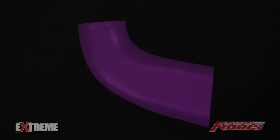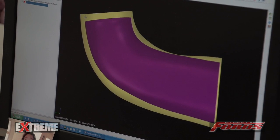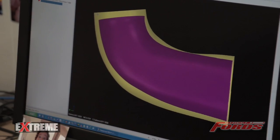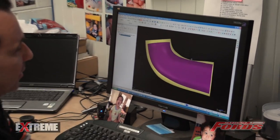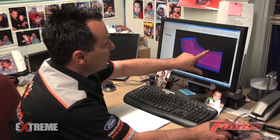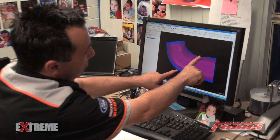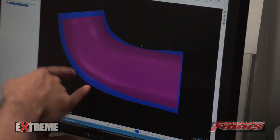Looking through the side, I can actually bring in the T-Rex port. By looking at what they've done, I've been able to see that by the way they've ported the cylinder head, they've brought the short turn back this far from the port. In actual fact, they're levelling up both sides of the turn, which is making the same area from both sides.